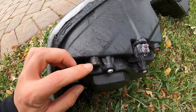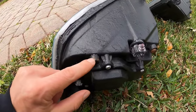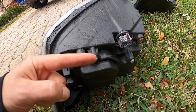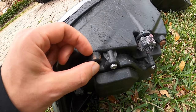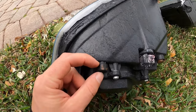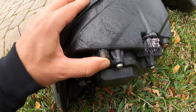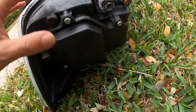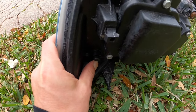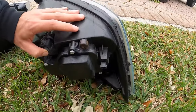It's not so much that water is coming in through here — it's more that the headlight has to breathe, and these were pressed in too far from the factory. Older headlights sometimes have these breathable button caps, or a 90-degree tube that comes out as a vent. Ram/Dodge uses these caps and some of them got pushed in too far, sealing the headlight so it can't breathe. You can see this one is pressed completely in, this one is pressed completely in, and this third one is pretty much pressed completely in as well.